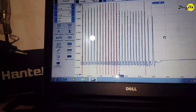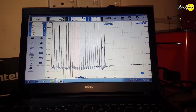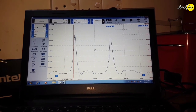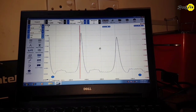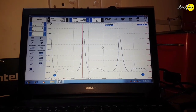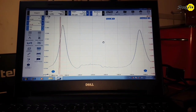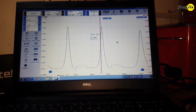Let's turn to the Picoscope. Let's zoom in the waveform and take a closer look. Do you see how quality a waveform has been given by this cheap pressure transducer? I haven't seen such a quality waveform with other cheap eBay pressure transducers, especially with a budget oscilloscope like the Picoscope 2000 series.